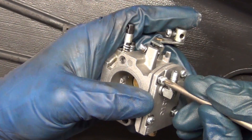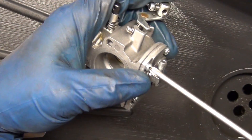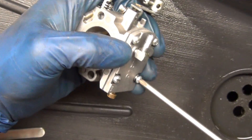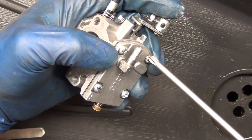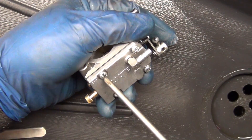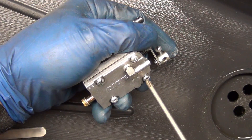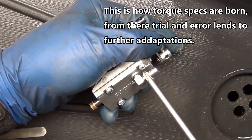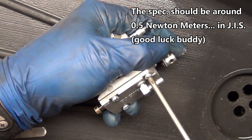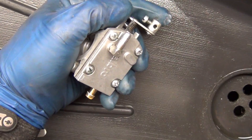Furthermore, especially with aviation like this, it causes it to not come undone. When you tighten your wheel down, everybody knows you use the star pattern — well, with gaskets it's the same way, so you just do an X pattern. I'm going to put my fist against the table, put this into my hand, and push in hard so that there's no stripping. Just bind it down and give it a little snug. You can feel when it just bottoms out and says that's enough. You don't want to strip the threads, but when it quits moving and gets real stubborn, listen to it and stop.